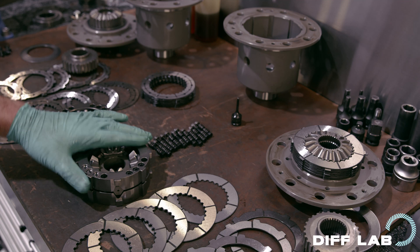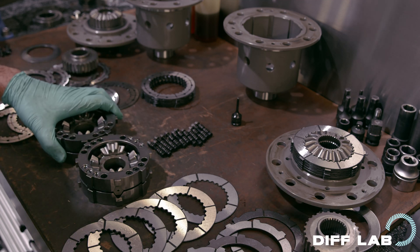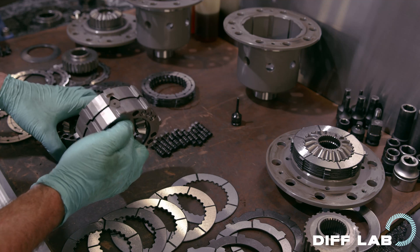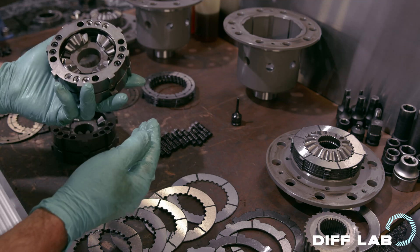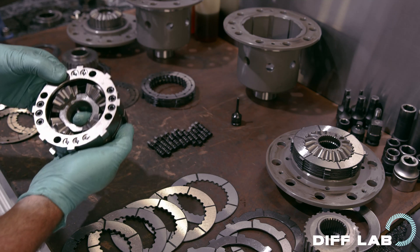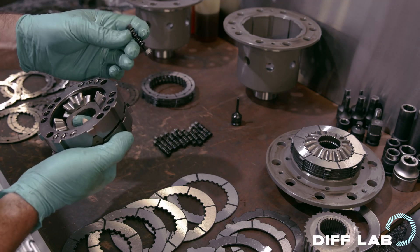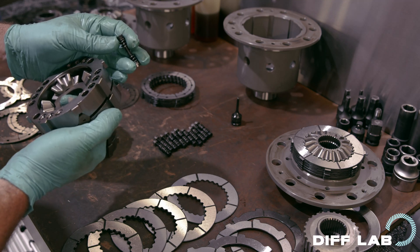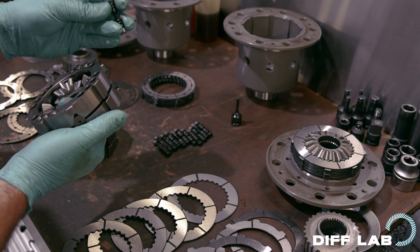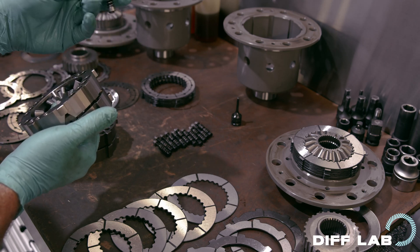It's all in here — this is what does it, so I'll show you. This is a unit here which I've pulled apart; I've taken all the springs out of. This is the unit from the Superlock — they are the same between Superlock and TCD. I'll show you how this works and why it's so special. This is a unit that's all together and you can see it has a whole bunch of these installed. These are out of the TCD, in this configuration here, and you can see there are little coil springs in there. It's a bolt with a little nut on the end and coil springs. There are 12 of them installed in here, and this is the negative preload system.